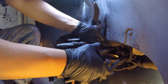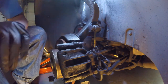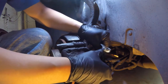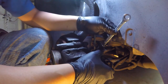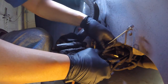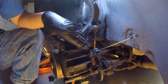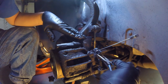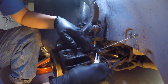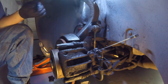What we're going to do is push on the lever and then jam something in between the lever and this little nylon bush here to basically hold it down. We're going to squeeze that by hand and make sure we slide the caliper out a bit so that the piston doesn't hit. Push that down as far as we can, then jam a spanner in there. Now the lever's compressed — take some pliers, move the nipple of the handbrake cable over, pull up, and it's free. There's the handbrake cable freed up.